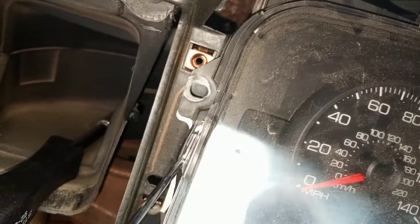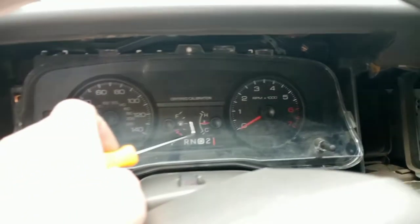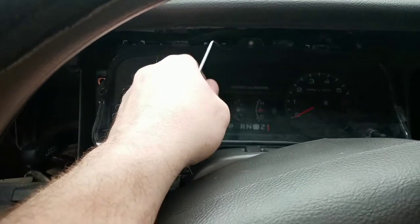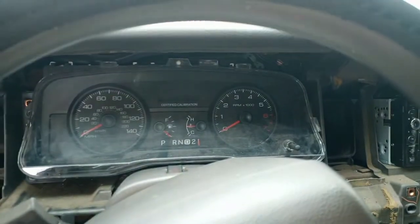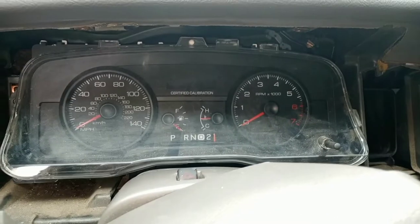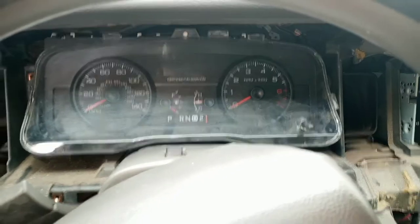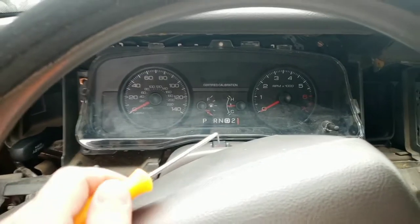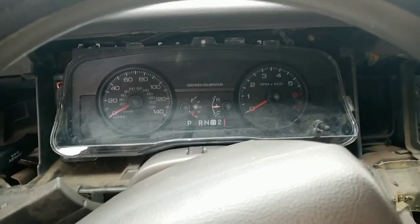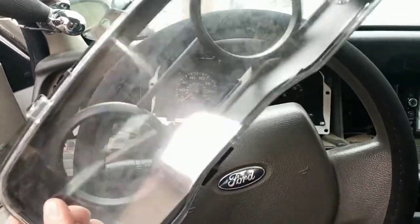Now I'm taking this curved pick and you have to get to these spots on the sides and on the top and work this lens off. Once you do that you get to your shift indicator, and according to another fellow on YouTube you should just be able to click that shift indicator out and the rest of it comes out. I'm gonna need two hands for that — one day I'm gonna get a tripod. Subscribe if you're still watching, it really helps the channel.